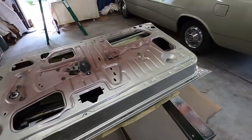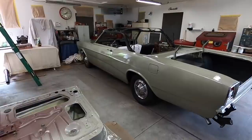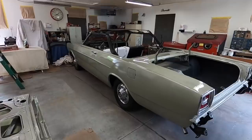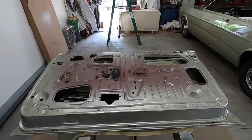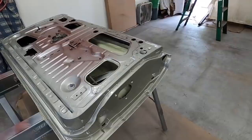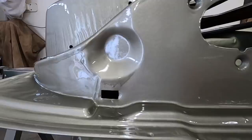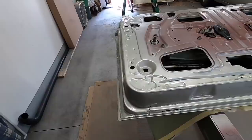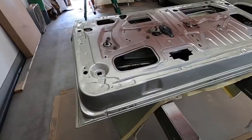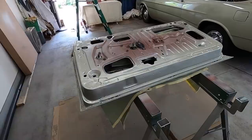I was thinking I might even just bolt it back on the car and then just mask everything off, but that plastic was real easy to drag over the car and really saved a lot of time - saved hours of masking. I may back it out - it'd be easier. I can take some hooks and hang it from the ceiling. The trunk lid I'm going to hang too - hang them both to spray them because I think they'll come out better. But that came out really really nice. That's why I paint this way - you get a nice coat, you don't get overspray, you don't miss little areas, it just looks good.